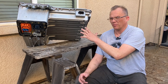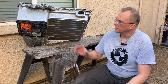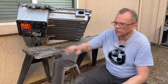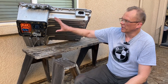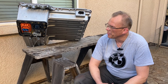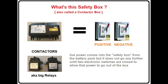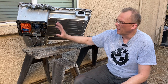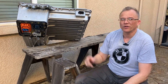So what do I mean by controlling this battery pack? How do you control a battery? Because we're dealing with such high voltage and a lot of amps, this battery pack can't be live at all times — it can't be hot. You can't just connect orange cables, high voltage cables, to this orange plug and get power out of it. There's a gatekeeper inside there that BMW calls a safety box, sometimes referred to as a contactor box, and that box contains what you could think of as switches that turn on both the negative side and the positive side and allow the power to come out of the battery pack. Inside of this silver box is yet another box, and that's what we're going to be technically controlling.